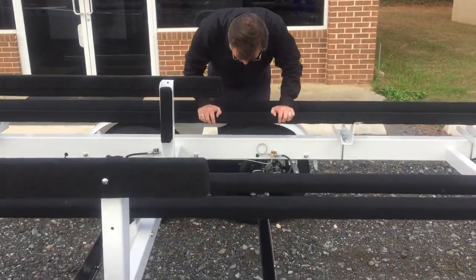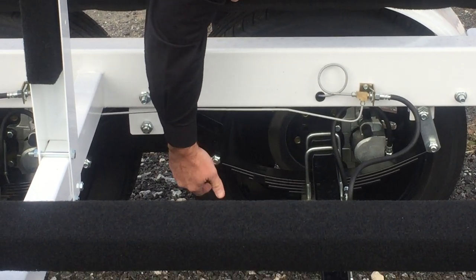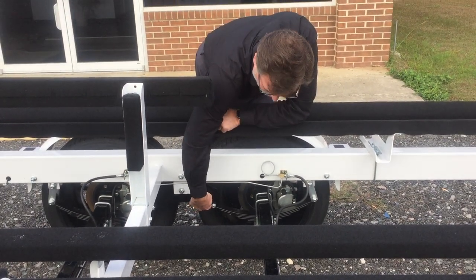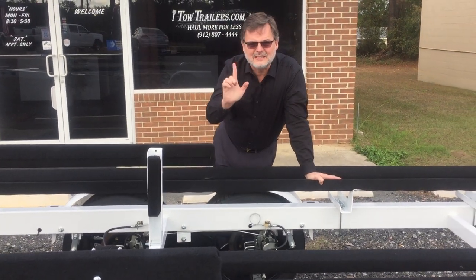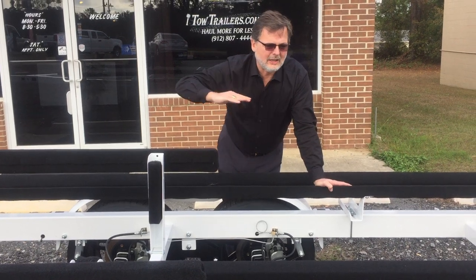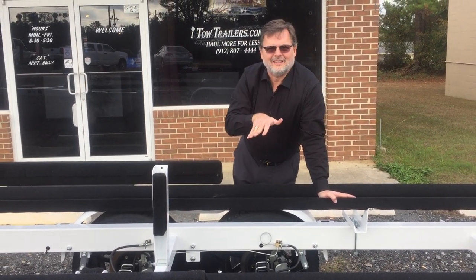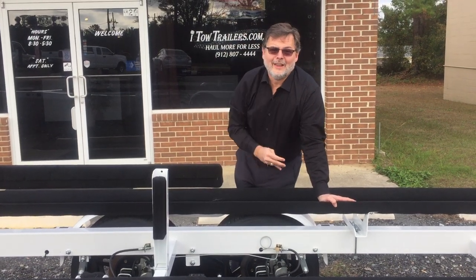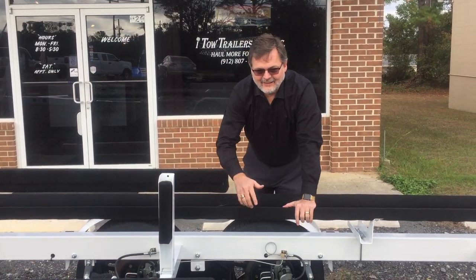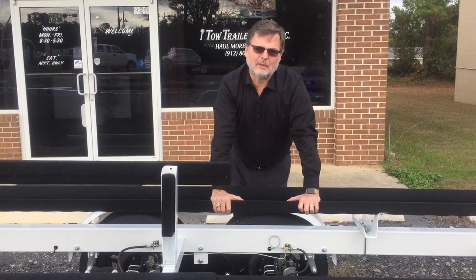We've made sure that our mount — you see that hole right there? Most folks are going to put that bolt, that strut, right up here, which is going to make your trailer ride higher. This one is adjusted down below, and that's special and specific to Yacht Club the way they do it. The reason you do that drop is it gets your boat lower so you get in the water a lot easier in shallow water. It allows you to be more aerodynamic going down the road — nice and low. With the center of gravity lower, you're not tipping. That sets it up so you can pull this boat wherever you've got to pull it without worrying about it flipping off your trailer.